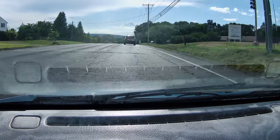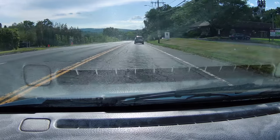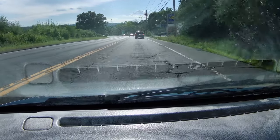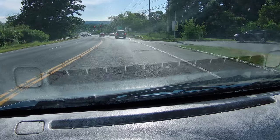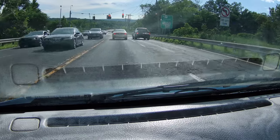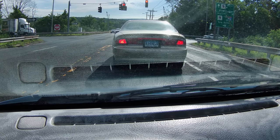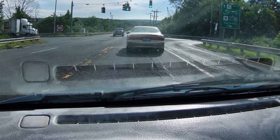I mean, it's still a three cylinder, like 55 horsepower engine. You ain't going to be winning any drag races, that's for sure. But that thing was lagging as if I had a little go-kart engine in it. Now it picks up and goes, keeps up with traffic going up the hills, no problem. This whole time it was set to 0 degrees, and I almost drove 1,000 miles like that, thinking it was just a worn out engine. Little Geo Metro that could.